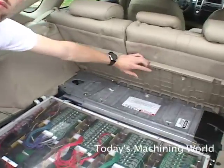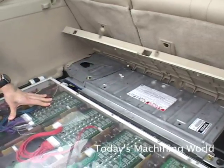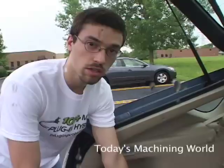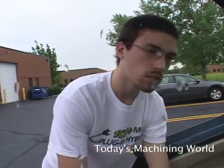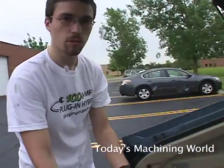This is the original battery under here — the original Toyota battery. It's a nickel metal hydride battery and it has a range of about 2 miles. The reason why it's so small is that it's only designed to capture regenerative energy, meaning when you're braking or when the engine is running in a manner that can charge the battery. It's only designed to have a small capacity because it's not designed to charge from a plug.